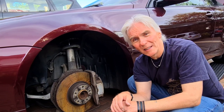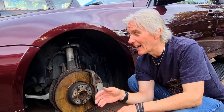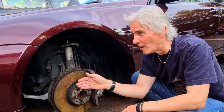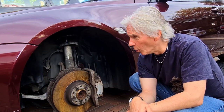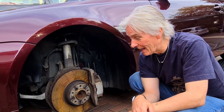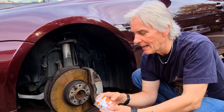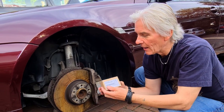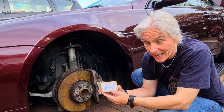It's quite difficult getting the camera in here, which is why I've removed the wheel. You can actually do it by just turning the wheel towards the inside of the light you're doing, and you should have no problem at all. But I've removed the wheel so you can see what I'm doing. First of all, you need the bulb, which is a D2S — part number 63126919886.